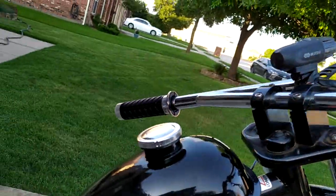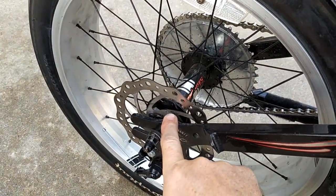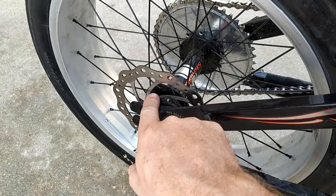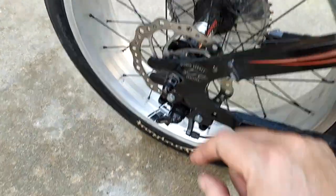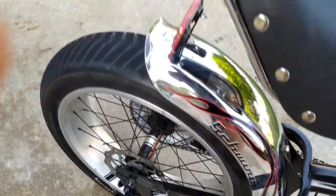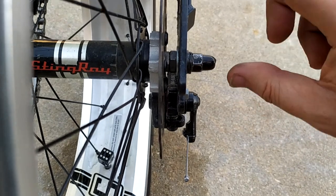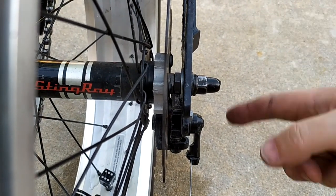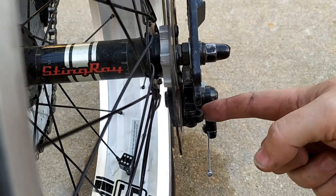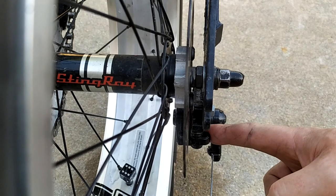The brake — here's the best part, this is about the only thing that works. I spun off the freewheel cassette, bought a disc brake adapter from Amazon, spun it on, and welded two tabs to mount a disc brake there. The problem is: with a freewheel cassette, pedaling tightens it on — that's by design, good. But this disc adapter spins on the same way, so if you're going 25 miles an hour and squeeze the brake, it's going to try to unscrew itself.